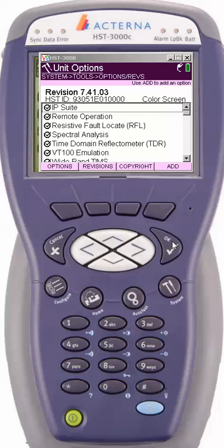On the broadband side, if you use this meter for broadband, the firmware update will have knocked out all your username and password information and put it back to a default status. If you know how to clone, you can clone the images back in — we'll have another video on that a little bit later.